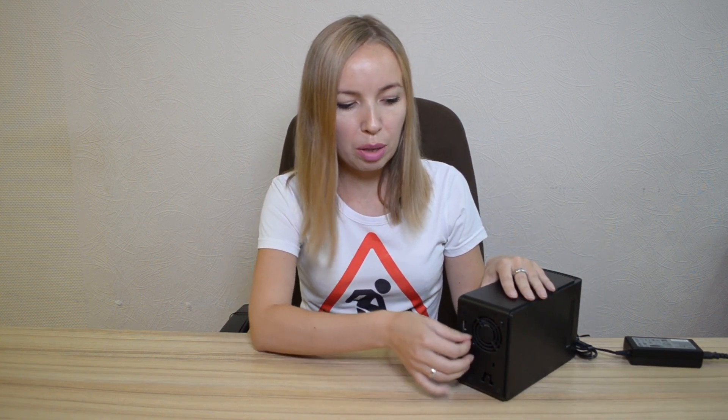To pull the disks out of the Buffalo, first you need to shut it down. There is a three-position switch on the back panel. Moving the switch to OFF commands the device to shut down. Blinking of the LED on the front panel when the Buffalo is shutting down is normal. Once it shuts down, remove the network and power cables.